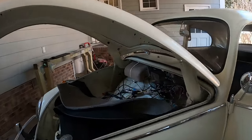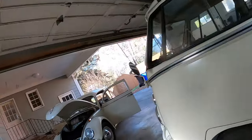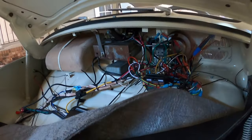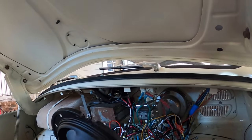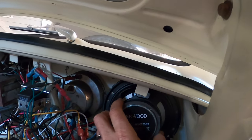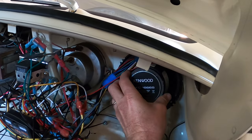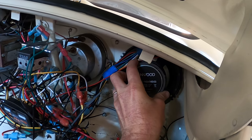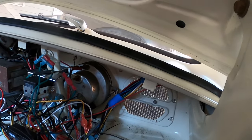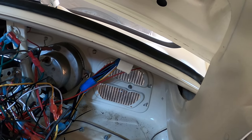I have a six-and-a-quarter inch Kenwood round speaker, and I set the stereo to three-speaker mode — two stereo rear speakers and one mono front speaker. I need to make an adapter from roughly five inches to fit the mounting hole, but that speaker might just be too big. The speaker for the dash hole is much smaller, so the easiest solution is probably just to buy the correctly-sized speaker that fits the bracket.